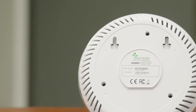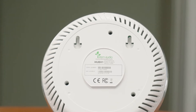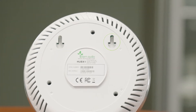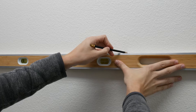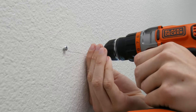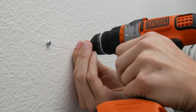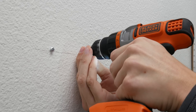First up, we're going to go over how to wall mount your Hub or Hub Express device. To mount Hub or Hub Express on the wall, look on the back of the device and you'll see two keyholes that are spaced 2 and ¾ inches apart. Using a level, mark two points on your mounting surface that align with the keyholes. Then install the provided Phillips head screws at the marked positions, using the provided drywall anchors as necessary.